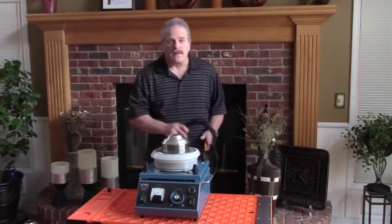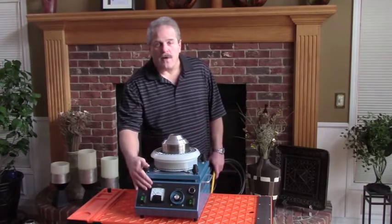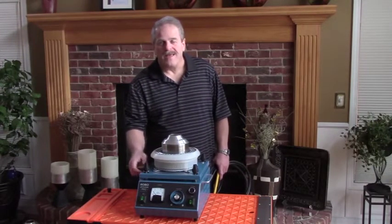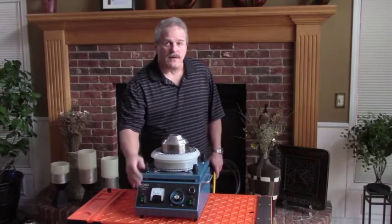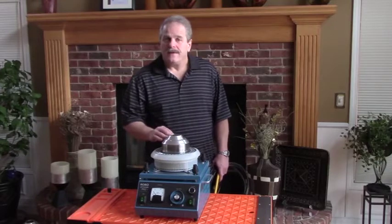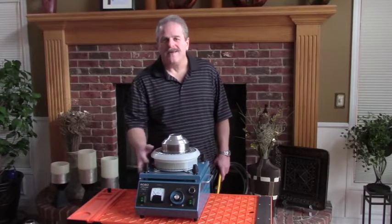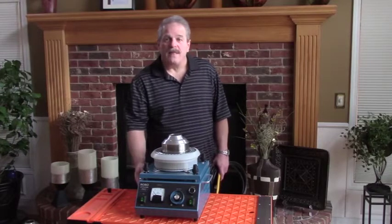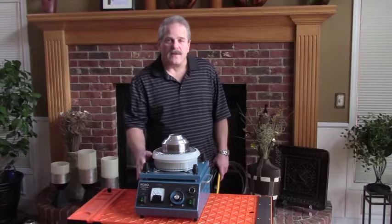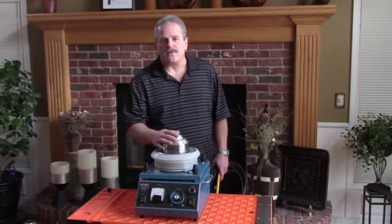At this point you can plug one of these into the back of the Robo JetFloss and turn on the power to test the motor, again only after making sure the deck is free floating. If however you turn on the power and find that the unit does not power on and the motor does not spin, don't panic. There's an internal circuit breaker for safety reasons inside of the main housing that, due to shipping vibrations, can occasionally trip. If that's the case, the motor will not start, but I will show you how to easily reset that now.